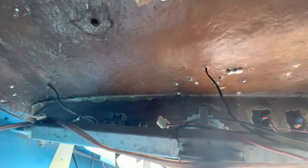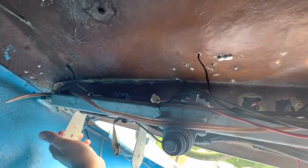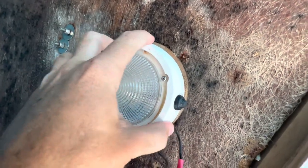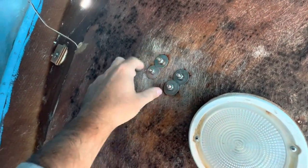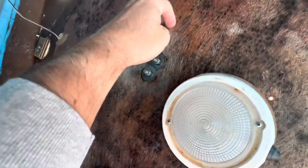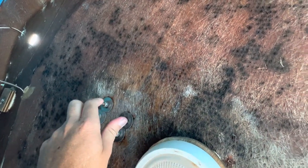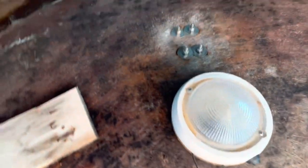I'm not going to be running this thing anywhere other than the Intracoastal. I'm not going to be running in the flats where I'm worried about depth, and if there's a rock, you're going to hit it before you even see it on the depth finder when you're running. There is a little dome light in here — at least somebody glued a piece of plywood there and screwed this to that instead of screwing into the deck. There are holes in the deck here from the four bolts for the cleat on front. I'm probably going to cut an aluminum plate for that just to disperse the weight a little more. I'm not sure if there's wood or foam inside this laminated piece here — I can't really see in, but I'm thinking it was foam.